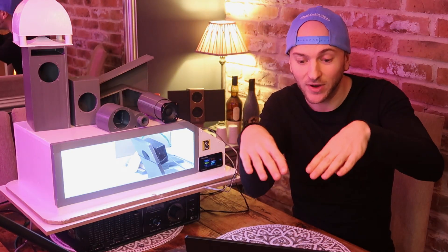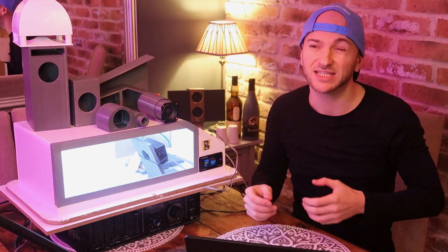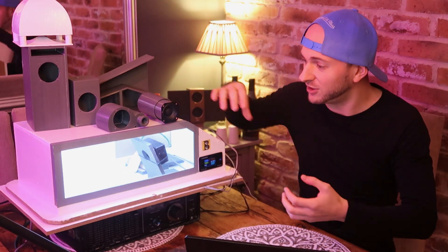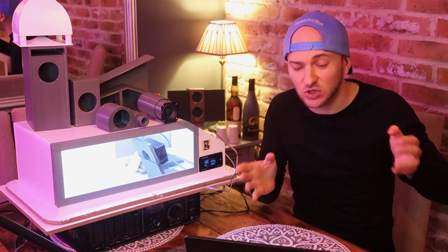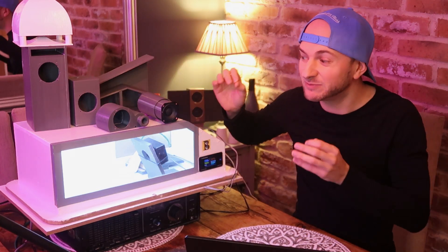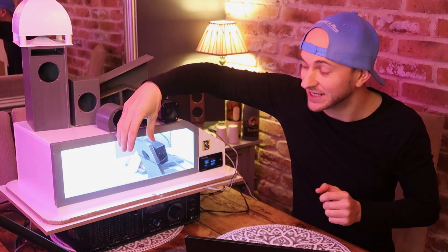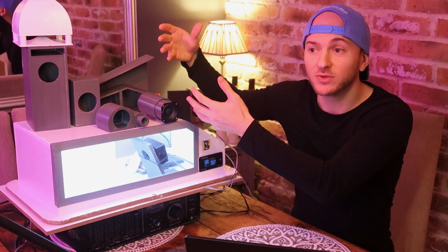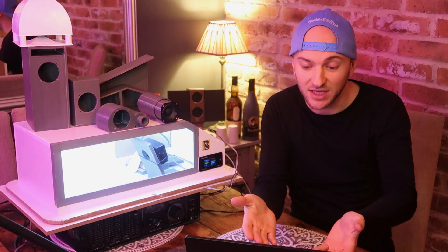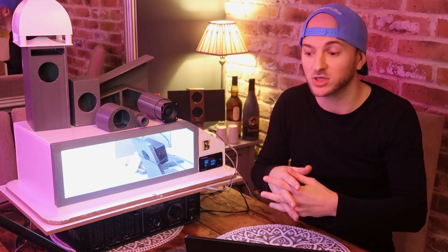That's why we've seen like 145 dBs on the lower frequencies on some of these enclosures that are tuned properly down there. And when you close the door off, it completely negates that Helmholtz mode that boosts the lower frequencies, meaning that the higher frequencies all kind of end up being the same. The dB levels should scale exactly - they shouldn't be split where the bass barrel is bottom with the door open but mid-range with the door closed. And the reason that actually happened is down to positioning in the cabin. When I work out the best position for the enclosure during dB testing, I generally play the 25 or 33 and move it around to see the highest score - I don't tend to do it with the higher frequencies.